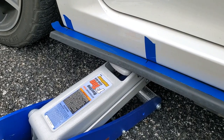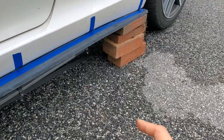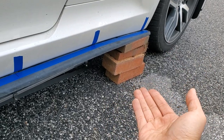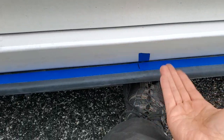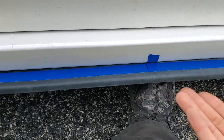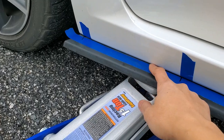Use your floor jack to hold the front part of the extension up to the bottom of the side skirt. If you have another floor jack, stick it on the back side. I'm able to get away with bricks for this demo, and if you have something that you can put in the middle here, you can just use your foot, honestly. Then take some tape and run it along the top here along the edge.